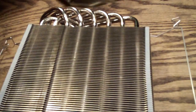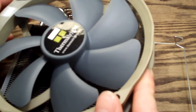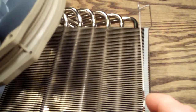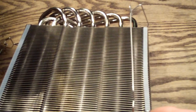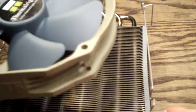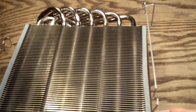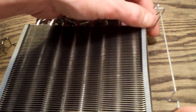Now the next step is the easiest of all. You're going to want to put this fan on after you put the GPU cooler on — you're going to want to put the clips on before. On the GPU cooler, you won't be able to mount it with the fan on. With CPU coolers it's the exact same way: you want to put the clips on first, but then you can't mount the cooler with the fan on. Just one thing to note there — there's nothing wrong with that, just something to keep in mind when you're installing it.